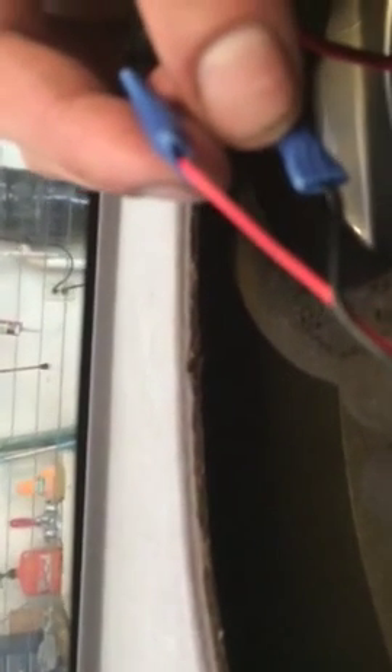What I had to do was take the wires from the stock speakers and strip all four wires, then connect each one. This one's green and black, so on your stereo system the rear system wire has to be an alternate color as well. Same goes for power — it's completely red here, completely black here. So again, green and black, red and black, yellow and black — whatever you have. You use connector butts, which I compressed using a pair of pliers. It's a lot simpler that way. I have a lot of slack to work with, so that's good.